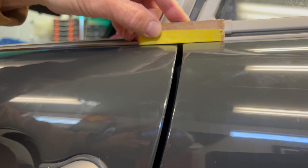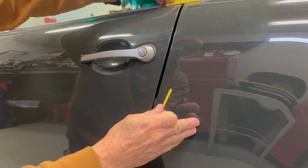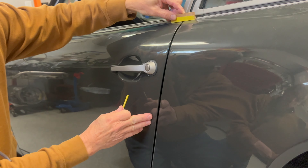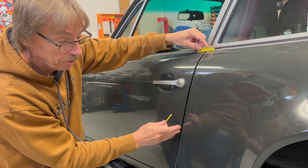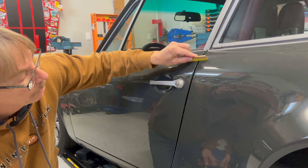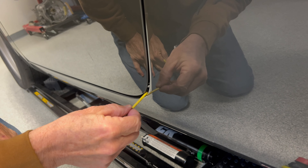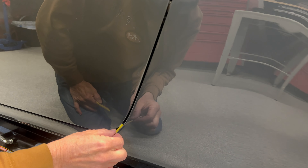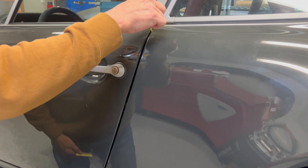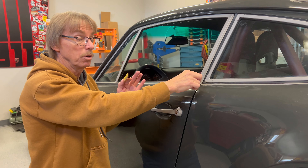These lips can be massaged in body work. If they've been massaged with either this set in incorrectly or not mocked up correctly in the shop when working these panel gaps, then some of this you're going to own. We want to focus on this radius down here — we're good there. We've got about four millimeters in this radius, which is pretty good. We're four millimeters, a little bit strong here, but we can make an adjustment on that later.